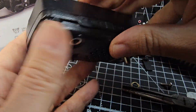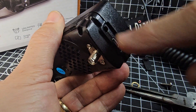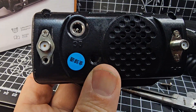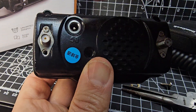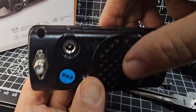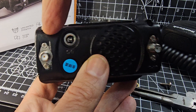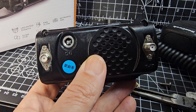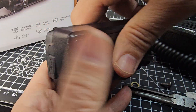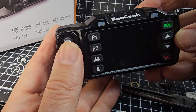As we close this, we have to place the knob back through there, and at the same time tuck in that Wi-Fi connector that's sticking out into that hole. That's it, tucked in. Push together, clip. There is a rubber grommet on the side that fell out — you need to push that back in. Put the screws back in — it's just a star shape I used to get that out. Turn it round, put the knob back on and the ring.